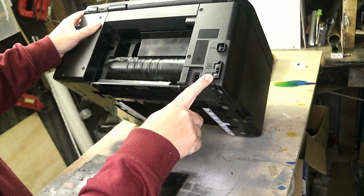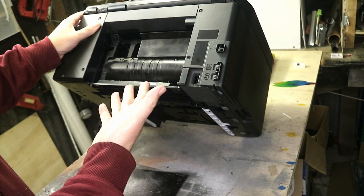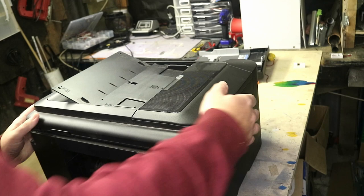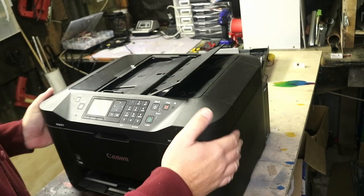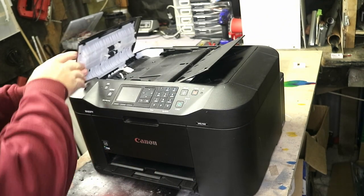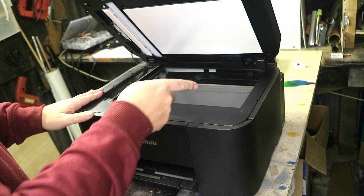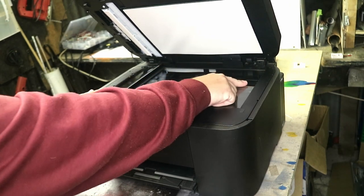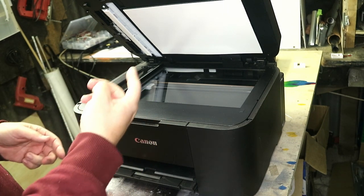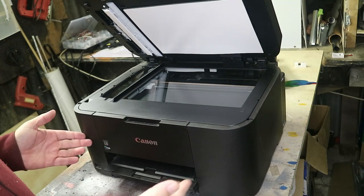And it does indeed have a fax line, USB printing, and I don't think it's got any networking. I can't check the control panel to see if there's any networking, because it won't let me do anything because it's bricked. So it's got a document handler on the top, which you can't use anymore, and a scanner, and unfortunately it's got just a linear DC motor for the scanner, not a stepper motor, so obviously the price point between memory and processor power and motors has got to the point where the memory is cheaper than buying a stepper motor. So we'll start to disassemble it.